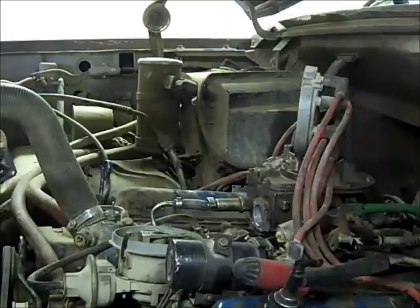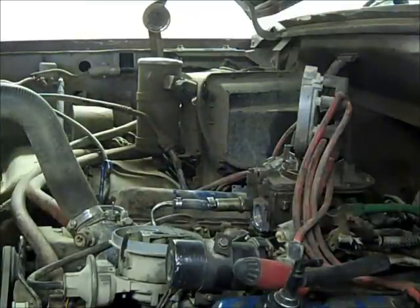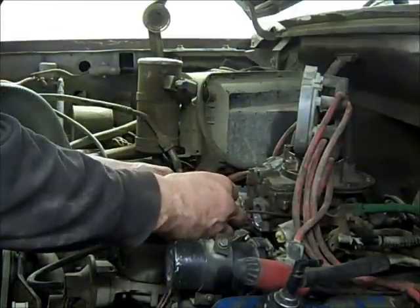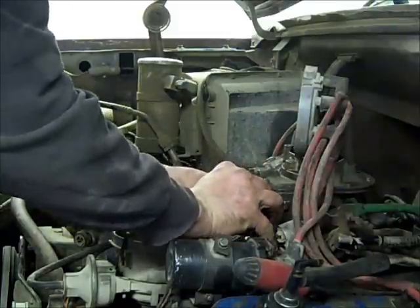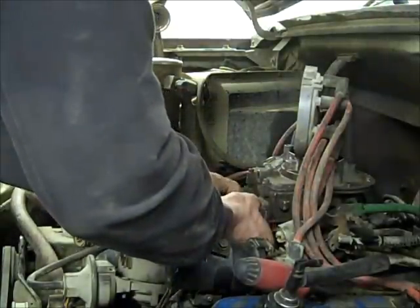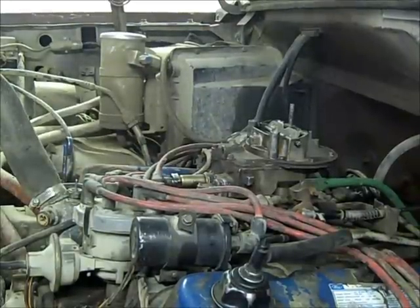It's a little different deal - it's got a different pin or something. We'll replace it with this diaphragm because I know this diaphragm should have the right length of pin for this carburetor. Could be that he got the wrong kit when he put it together. We'll go with this newer spring because it looks a little less collapsed, and we'll put her back together after we let the gas dry up - I have a terrible fear of fire and only have one tiny fire extinguisher in this garage. We'll have Phil take it out for a spin. Keep in mind it's going to be out of gas in the bowl, so it'll take a second of cranking to get it fired up.